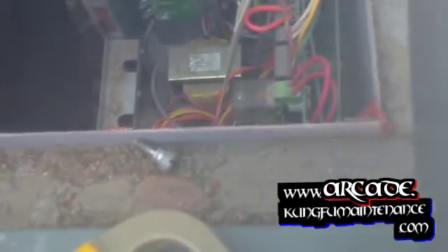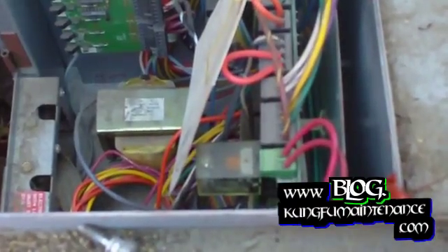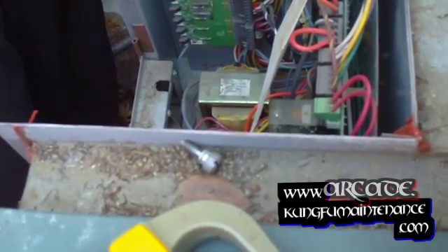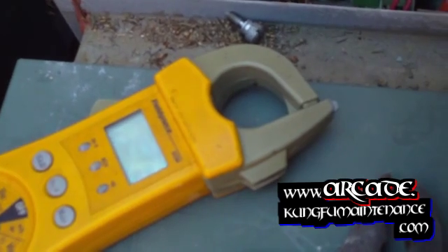You're testing it at the point where you hear the relay click, and you'll see the green light. When this green light turns on, that tells you it's fired. When that light comes on, that's the point where your amp reading counts. It'll always rise a little bit once it fires and then shut off. You're looking for the point where it fires — that's the true reading, not before or after.